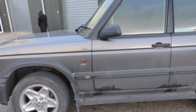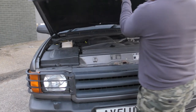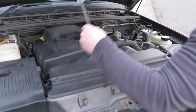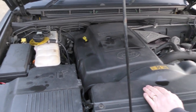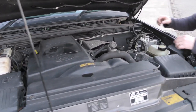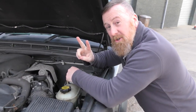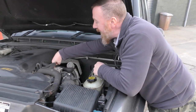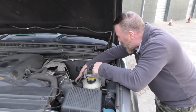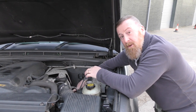Let's have a look under the bonnet and see what we're going to be doing to this motor. As we lift this massive bonnet — water, we're going to be draining it all out. It did leak but it's not too bad now. Round this side are your two oil filters. Remember, you have two oil filters in here, not just one — a centrifugal one there and one further down here. Both, once you're there, are easy.